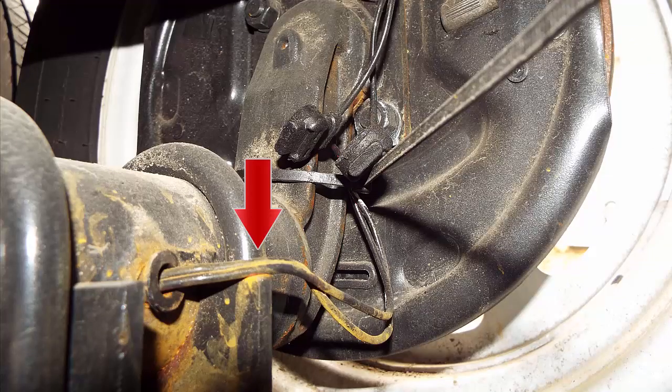I also noticed the two brake lines sitting on top of the shackle that bolts the shackle to the axle itself. Over time with vibrations, these wires are going to wear, and nine times out of ten you're either going to blow a fuse or lose your brakes completely, which in my opinion is not a good thing.